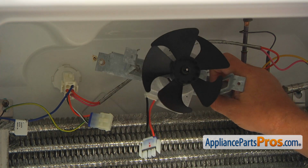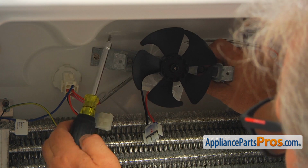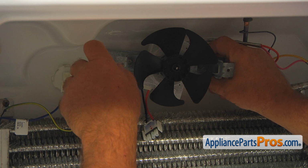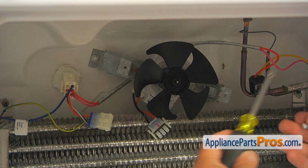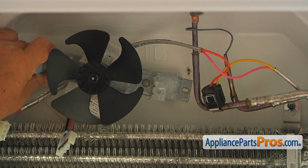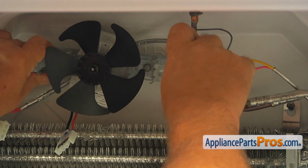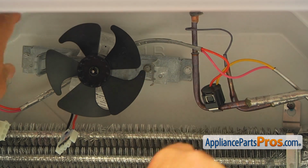Again, I'm going to lift up the assembly, bring it up to this hole on the left, and then I'm going to use a 1/4 inch nut driver and a 1/4 inch screw, and I'm going to install it. I'm not going to tighten it real good, just a little bit, so the bracket is still movable. And then on the right side, I'm going to line up the bracket with the upper hole. Remember that? Upper hole, not the lower one. And I'm going to secure it with this second 1/4 inch screw. Then I'm going to tighten this one.